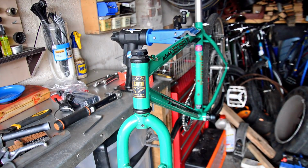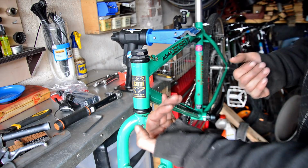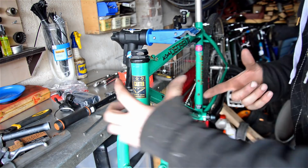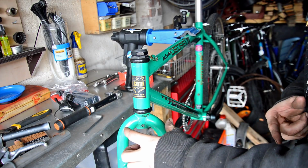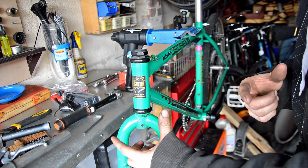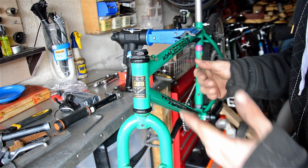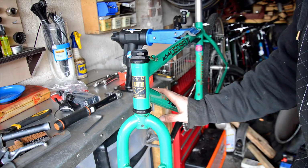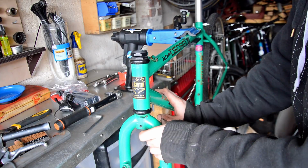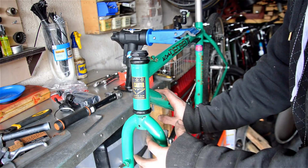Okay, back end's all assembled. I have just had to move the bottom bracket across a little bit. The original one on the Saracen was 118mm, a 73mm bottom bracket with spaces to fit a 68mm shell. This is a 68mm shell, and stupidly I just went ahead and ordered a 118mm axle designed for a 68mm shell. So in theory it was 5mm longer.